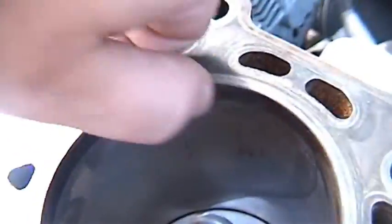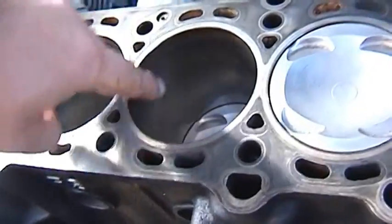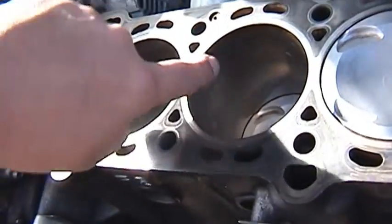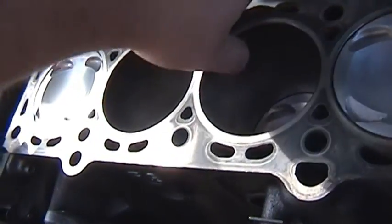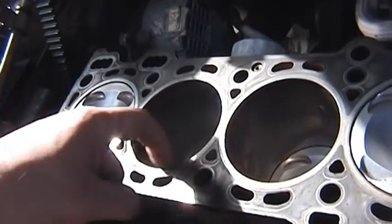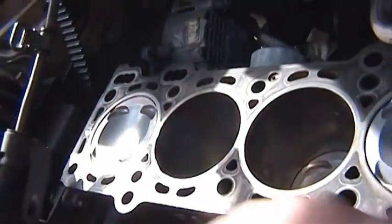So that's a friction point I want to try and get rid of. I've been cleaning it up the same as the piston head — using a little bit of degreaser on a towel and wiping the lip, then going at it real gently with an aluminum brush. I know that's going to score a little bit, but I would rather have it score on this lip than have the carbon buildup on top of there, because I know that carbon buildup is going to make the top of that piston stick a little bit. I'm on the exhaust stroke right here, so this is the perfect time to clean this, and then the next crank around will be back at the compression stroke and I'll do the same for cylinders one and four.